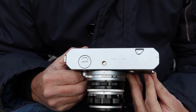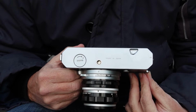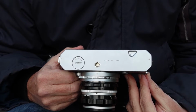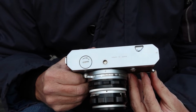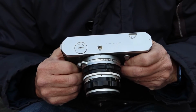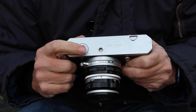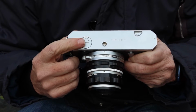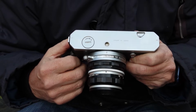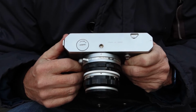This camera uses an MR9 battery, or it originally used an MR9 battery. You can use a PX625 alkaline battery, or a wein cell, or an LR44 battery with an adapter. Quite easy. I like how well made the battery chamber and electronics were for this camera. The light meters in these usually work pretty well. It's not often that I come across one where it doesn't work.